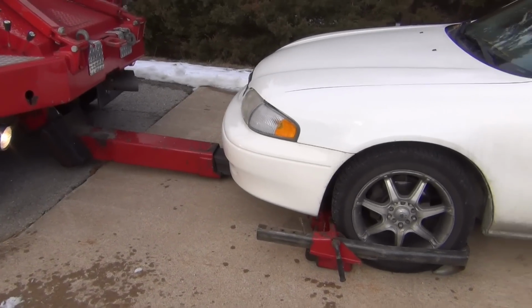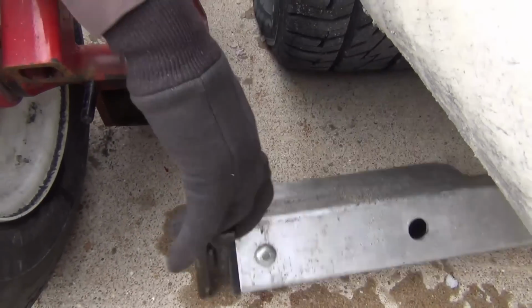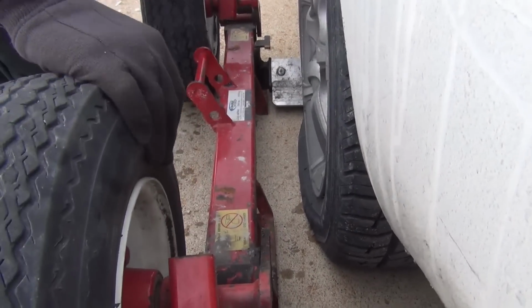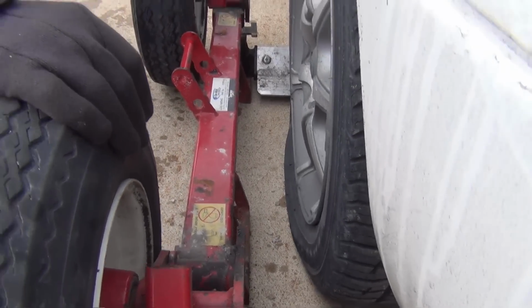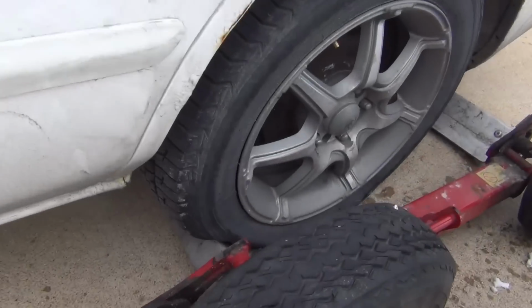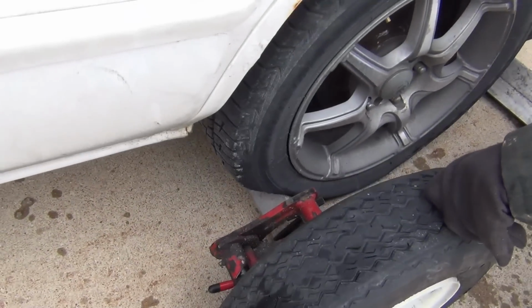Like playing a game of pool, you must set yourself up first. You'll want to have the front wheels in the wheel lift and up off the ground slightly so you can move the car forward and backward. Start out with the front dolly bar on the side with the flat and extend the stinger out far enough so that you can have some wiggle room. Secure the front dolly bar in the dolly slot that you want to be in. Make sure it's tight enough so that the tire will not drag. Be sure that the other side is not in any slots.